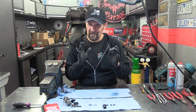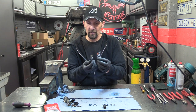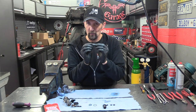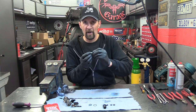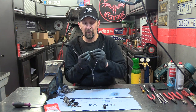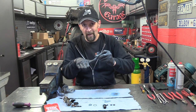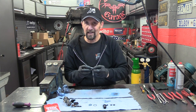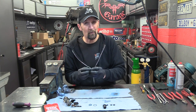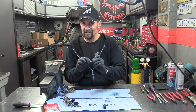I'm just going to clean everything up, clean the surface before I get involved. It's a bit of a surgical operation — it has to be done spotlessly clean. The real wear is in the piston itself, this little solid cast piston with two seals on it. This is where the wear occurs and when it starts to leak past. Leaking past means that as you push the brake on, the piston pushes up against the fluid, but because the seals are worn it just oozes past them. So your brake pedal sinks — although the brakes are on, the pedal is sinking. You find yourself pumping it to keep it on, and that's quite a dangerous situation. It wasn't causing that problem, but nevertheless I'm going to re-kit it from scratch with a brand new piston and seals.